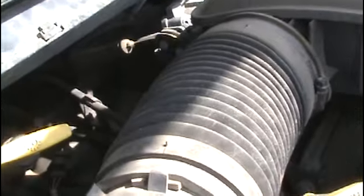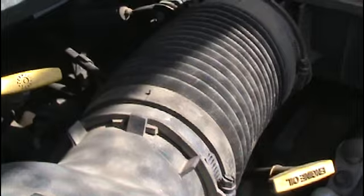And you gotta figure out where the low pressure port is on your vehicle. And if you go to idqusa.com and go to their port locator link, it will show you where most vehicles have it. On my Dodge 1500, it is right here.